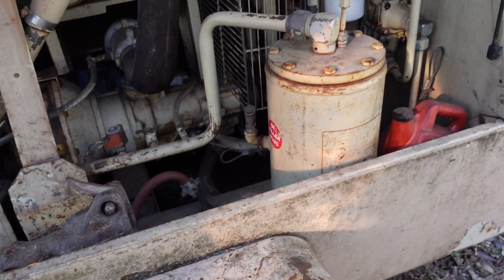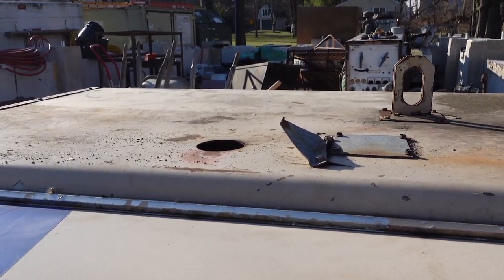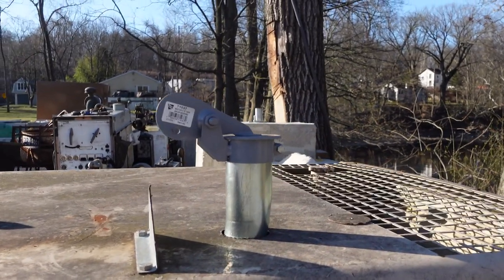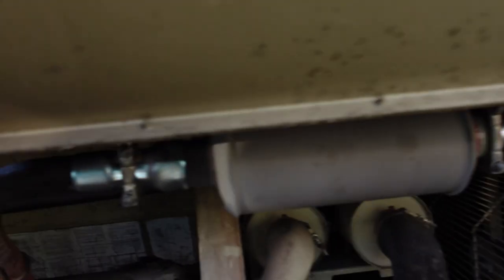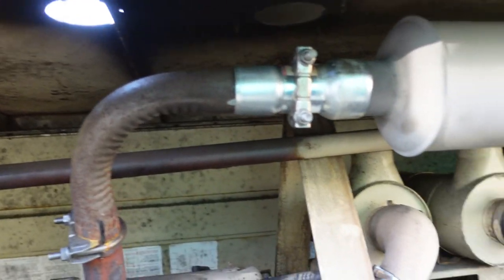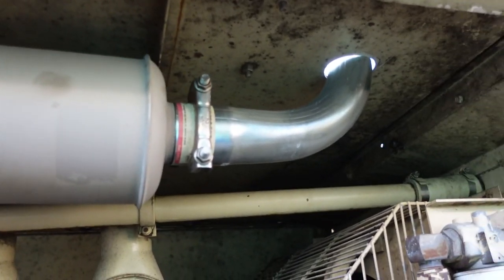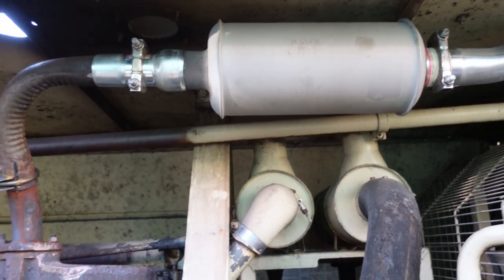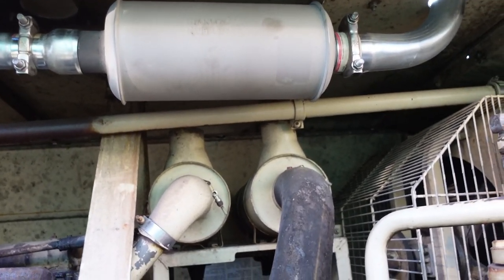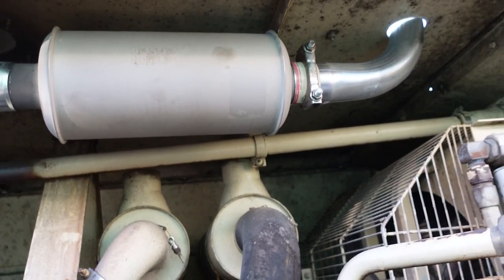I'll show you guys the exhaust that I did here. So it had a cherry bomb on the roof, mounted there and there, which I'm going to take off and cover that hole as well. As you can see, my new deal there with the flapper. I just went to tractor supply. This 90-degree fitting was already here but it was on the outside of the compressor, so I just put that 90 back on and connected it to this tractor supply muffler — it was for an International Harvester, I believe — going up nice and simple. It's holding itself up but I know that won't last long with vibration and bouncing down the road, so I do have universal strap mounting to put on there.